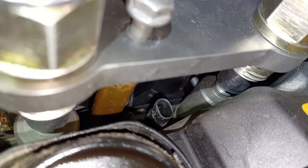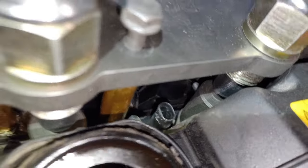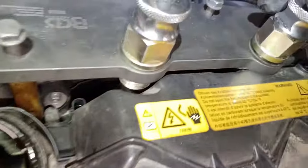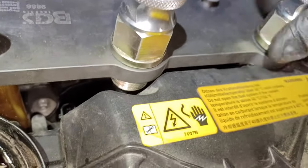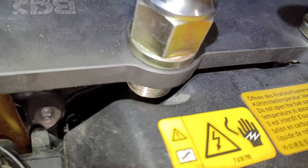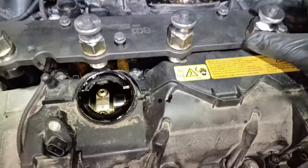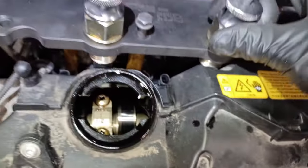There's the puller for the injector. You just whack it on, dead easy. Don't go too tight, just bottom it and then turn it back a bit. Otherwise they seize on later, like that. And the last one, number three, or if it's a French car, number one, is a bit more tricky. And that's it, essentially. And all we need to do now they're all on, is counter turn these that way to undo everything.